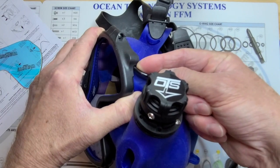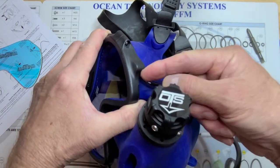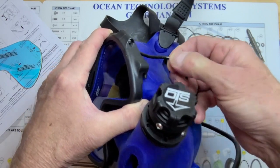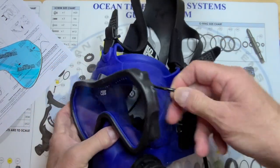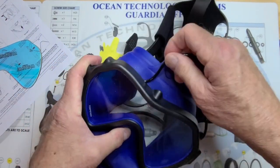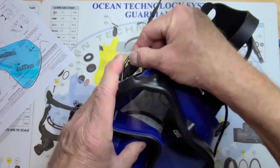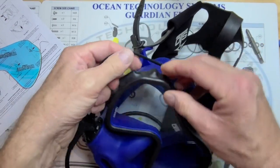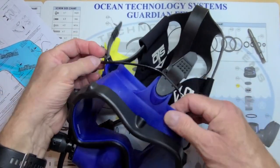The wire of the ear microphone assembly goes in a channel here, and you'll see where it's hooked into a little slot right there. I'm going to peel the cable out and take it out. On the other side, there's another one of those little notches. I'm going to pop it out of that notch and flex it back to the rear.